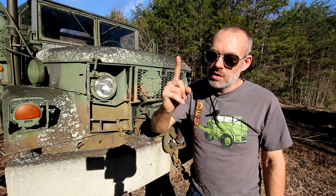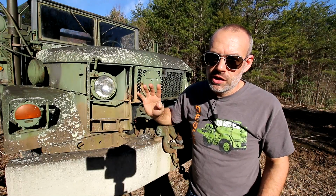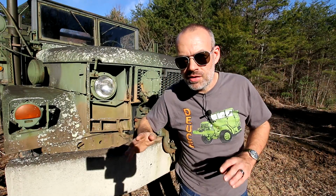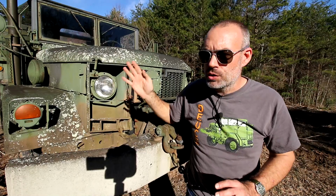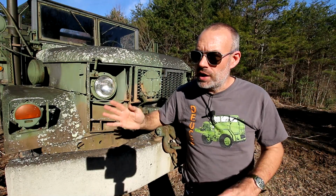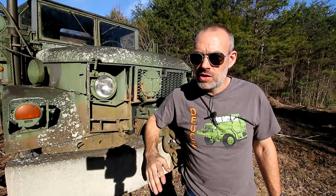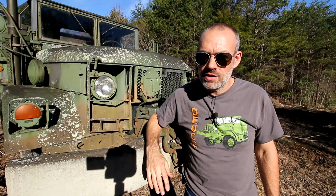Number one, the most likely issue is you dropped the ground. Your ground wire is no longer connected to your chassis. It happens all the time. If you have an electrical issue, electrical bug or gremlin with your Deuce and a half, then check your ground wire for whatever that system is, because that is a common issue with Deuce and a halves. The grounding is not that great in this vehicle.